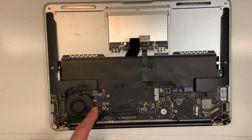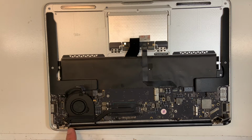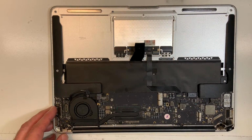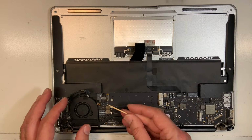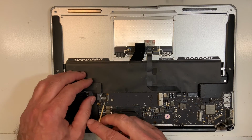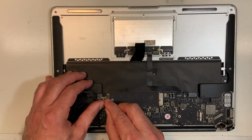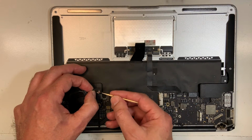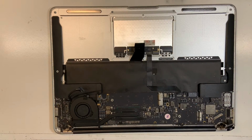It's super gentle. Why? Because if you damage the cable here, the cable will run behind the screen, and you're in serious trouble. So always be super gentle. I've been doing it for so long, so now I know how much pressure to apply. But if you're not sure, don't use metal, use a toothpick or something, just to loosen it up a little bit. See, like that. I can do nothing wrong, because if you break this cable, well, it's not fun anymore.